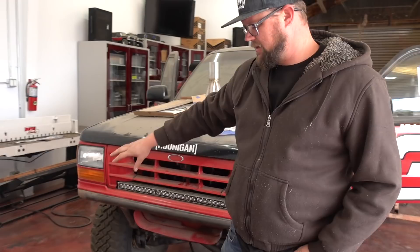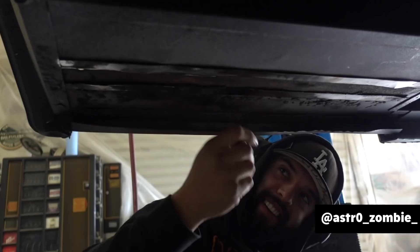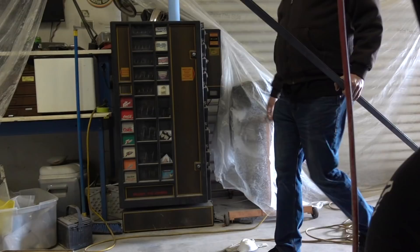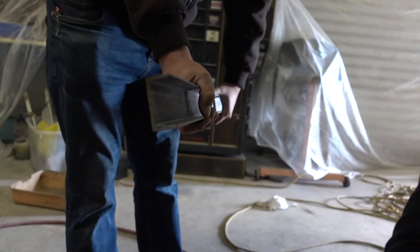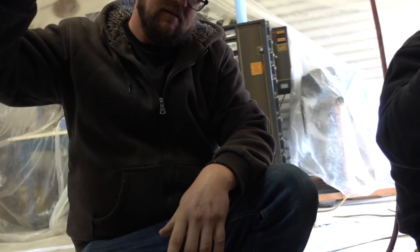Chris has cut the last of the rust out. We had the channel on the bottom of the body. What are you working on, Chris? Taking these off — no more crunching. All that was rusted out — going to replace it all with this C-channel. Heavy duty. This is going to go up here and we'll have a nice jacking point for the body that's not going to crunchy-crunch. And also for all the people selling the merch — they won't fall through the floor.